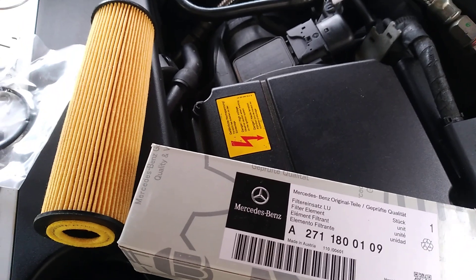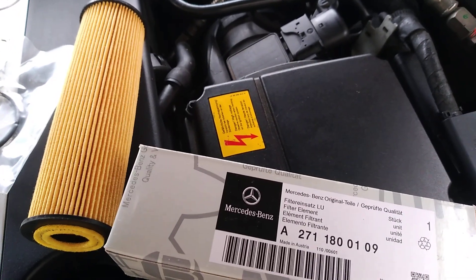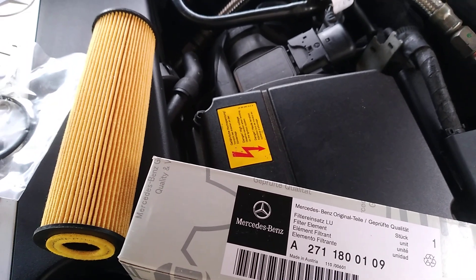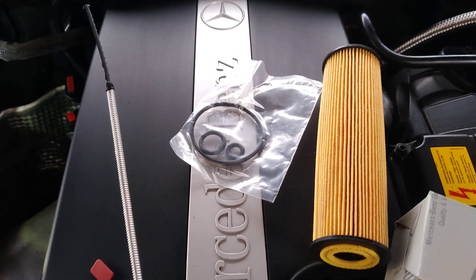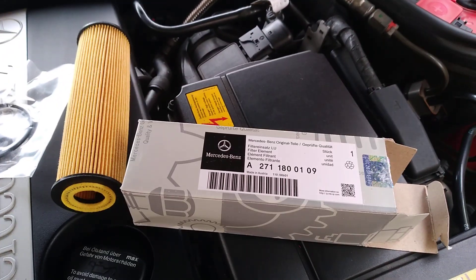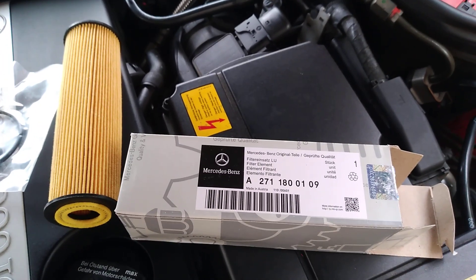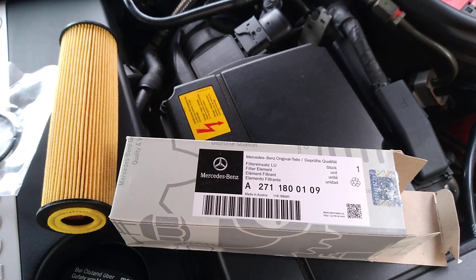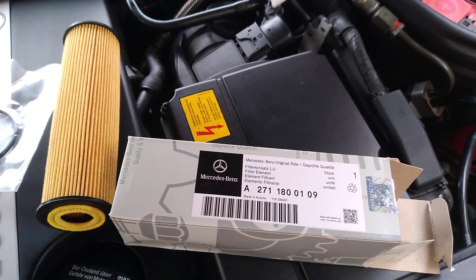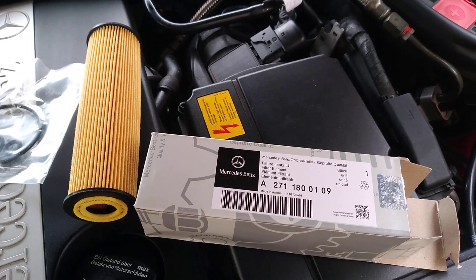One reason I'm careful restarting cold is that it's a bit dry - I make sure she cranks without catching first so I don't put pressure on any parts that may not have enough lube oil around them, especially up around the camshafts. This task isn't beyond the average handy person. A jack to lift the car helps as it's quite low to get to the drain plug, and of course you have to remove the bottom covers that cover the transmission area.